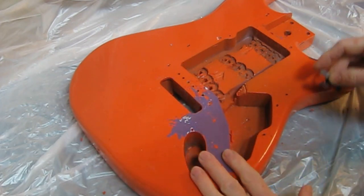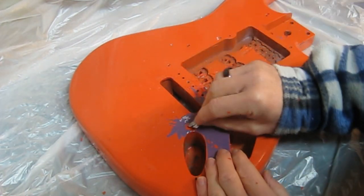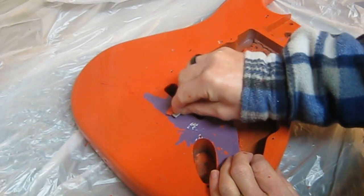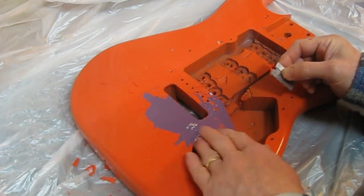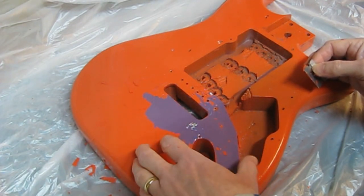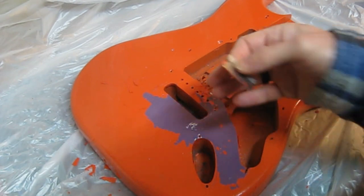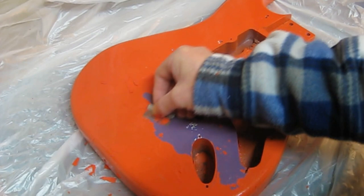We're going to have to try and get down basically to the wood, or even to the sealer on top of the wood will be ideal, and then we'll start again from scratch. So if I left this on now, we'd have nothing but problems. We'd have reactions, we'd have bleed through. The amount of material we'll be putting on this with the metal flake and the base coat, we're going to get delamination if I left all this on. So all this is going to have to come off. We're going to strip it right the way back.